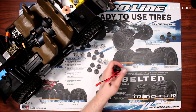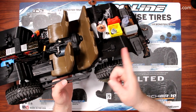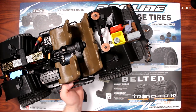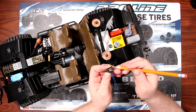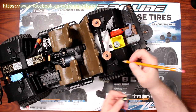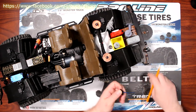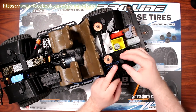Once I dismantled the kit, I grabbed four lights and put them in the vehicle, determining where I wanted to place them. I cut a channel in the fender basically the same size as the physical LED. There's a ridge around the side. I measured that, scribed on the fender with a crayon, grabbed my Dremel, and cut the square. I test-fitted the LED, removed a little material until it sat perfectly.